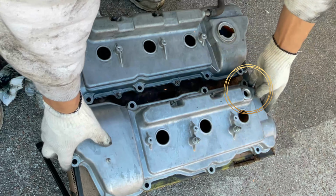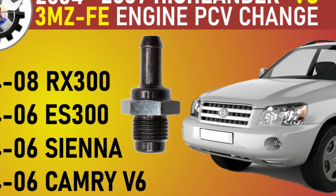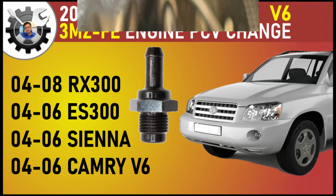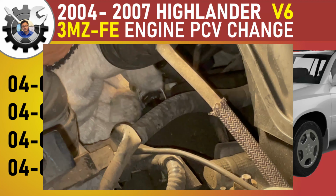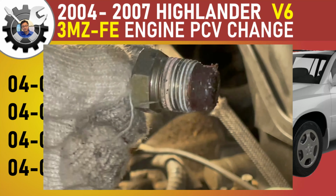The PCV valve is located on top of the rear valve cover. I have a separate video on PCV valve replacement under normal conditions with nothing taken apart, but since you'll be removing the rear valve cover, this will be easy work. So I strongly recommend that you replace this cheap part that serves a very important function.